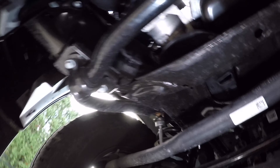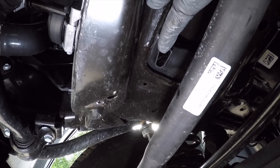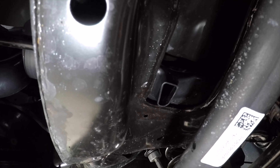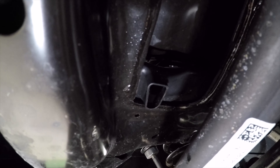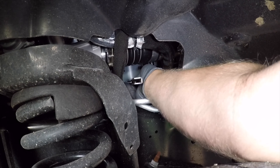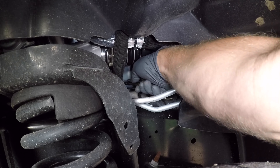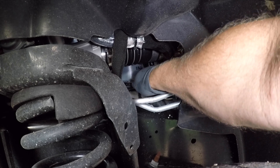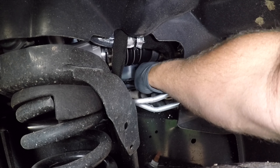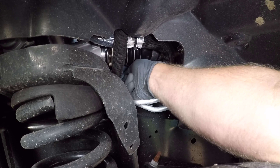You can see that there's a little drain hole located right here, so if any oil does happen to spill, it will come out there. There really is no other easy way to access the oil filter, so I'll be going from the right wheel, putting my strap wrench or oil filter wrench in, and loosening the oil filter towards the back of the truck.